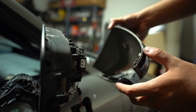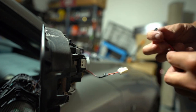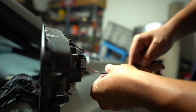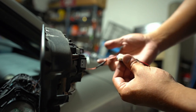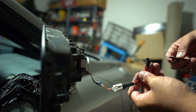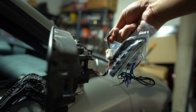The light is usually screwed into the mirror but I left mine without the screw — it stays pretty snug. The bottom black piece can separate from the mirror cap, but I like to leave it as one piece and set it aside. The OEM connector is just a plug — push the pin connector up and remove it. We don't need the OEM one anymore. The new connector is provided in the kit. Plug it in — there's a little notch so it only goes in one way. The black wire goes to the orange wire, and the red wire goes to the pink wire. Then we match the pins into the push connector. To confirm, I unlock the vehicle and the lights turn on — we are set.